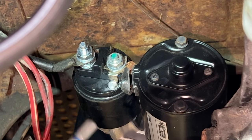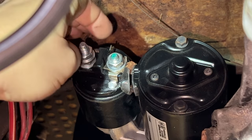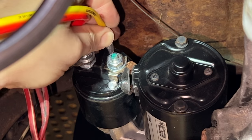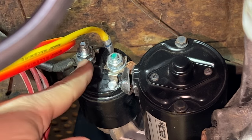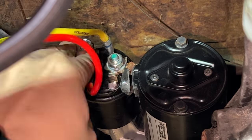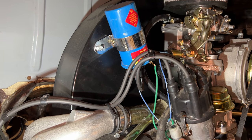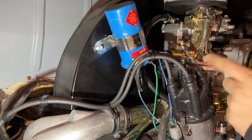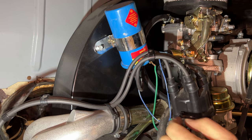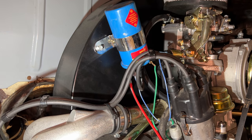Two of my wires I'm going to connect to the starter. This wire right here runs directly to the battery — it's disconnected right now. Then there's a terminal here that triggers the starter solenoid and runs the starter. The yellow wire will slip right onto that connector and then I need to undo this nut and put my ring terminal there. Here on the ignition coil, this green wire runs down to the distributor — that's not the one we want. This blue wire runs up to the fuel shutoff solenoid, so this is where we want to apply our ignition. We'll connect this connector up to the ignition coil. Now our vehicle is fully hot wired.